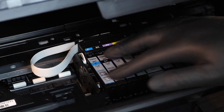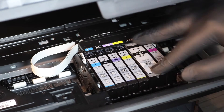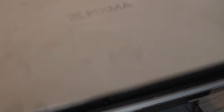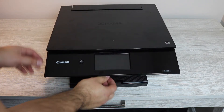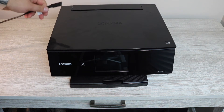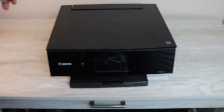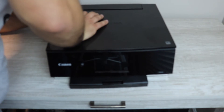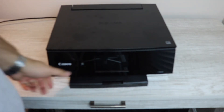Assuming you've got some fresh ink cartridges, go ahead and replace the ink. This is pretty much the end of the physical repair. There are some additional instructions, but this is basically the gist of what you're going to use the cleaning kit for. Now you're going to want to power the printer on and plug it back in — this whole time it should have been unplugged.